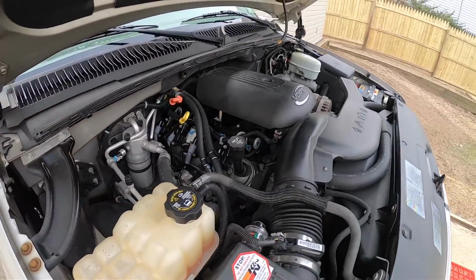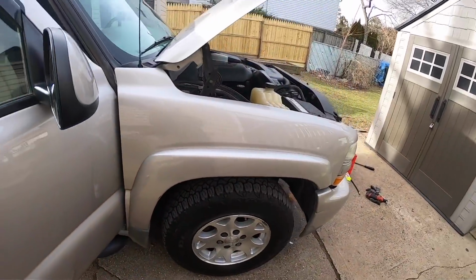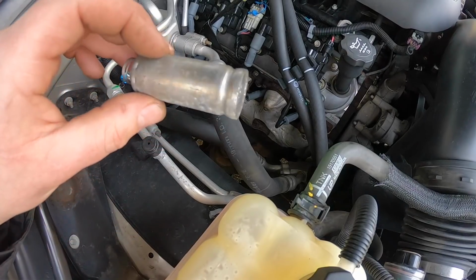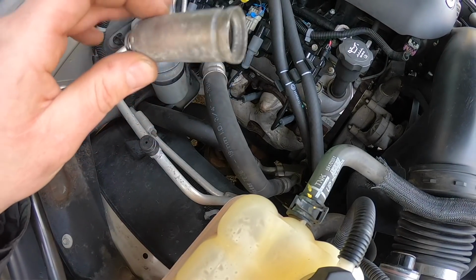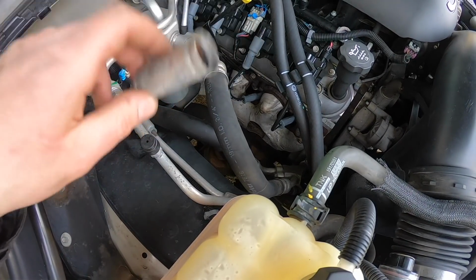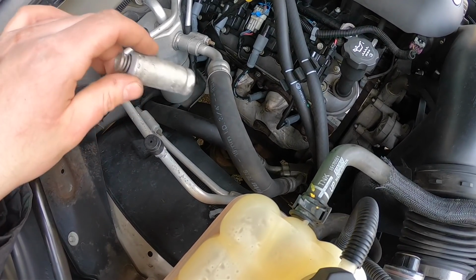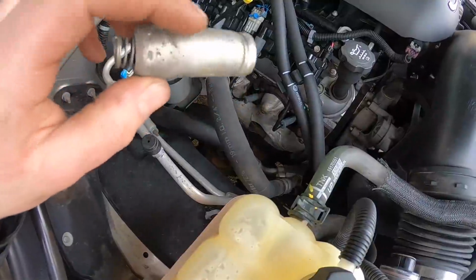The other thing I forgot to mention, I didn't put these little heat shields back on. These wires are a lot more resistant to heat than the stock ones. Plus these don't really fit on the MSD wires that great, so I just left them off. I didn't put them on the Camaro either, and it has long tubes and those wires have been fine. They're not getting toasty or anything like that.